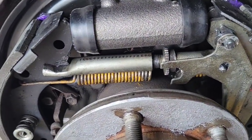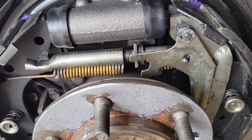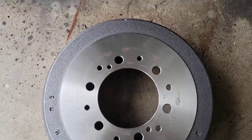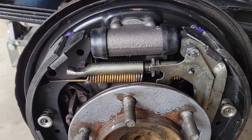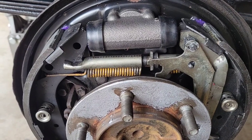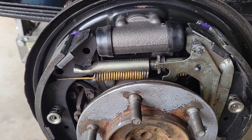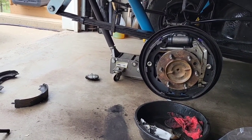Before you put your drum on, make sure the shoes are adjusted properly. There's a process per Toyota to do this but I don't have that tool, so basically I'm going to adjust the brake shoes out and put the drum over them and continuously do that until they're barely touching — just a little bit of drag. Then the parking brake will do the rest: just keep pulling the parking brake until things start to tighten up. You want 7 to 9 clicks, and then they should be adjusted correctly. You don't want too much drag but you also want them to hold in place. Thanks for watching — please like and subscribe for more videos like this.